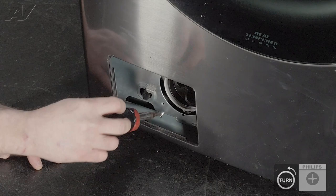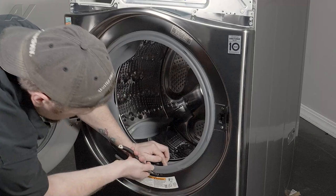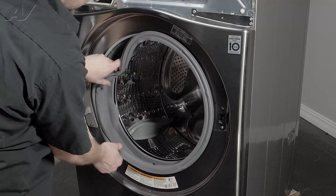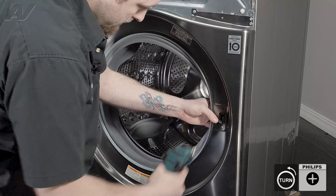Next, we'll move up to the door. Go ahead and open it up. We're going to push the seal in and remove the door switch. The seal is held on by one clamp ring on the bottom — just use a pair of pliers and peel it off. Then lift up on the bellows and lift it off the ledges so you can slide it inside. Put your hand inside and hold the door lock while you remove the two screws, then push it in and let it hang down.